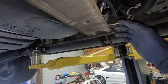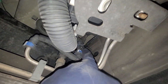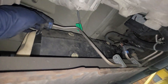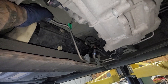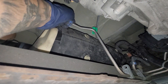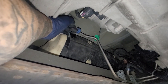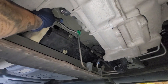We have our hard lines right here. I'm going to be dropping these down a little bit or unplugging them — unplugging this fuel line right here on top, because that's connected to the gas tank, and then obviously unplugging this one too. When unplugging these, be very careful — no smoking, no spark. You're just going to ignite otherwise. These little tabs you have to spread apart, like opening your legs, and then just pull it back. Don't take them out all the way — you don't need to. Be careful with your eyes when working with fuel.